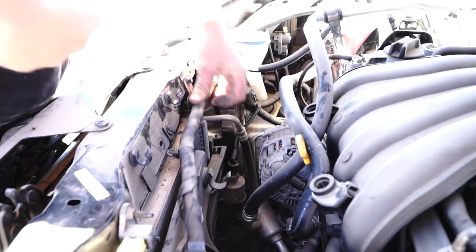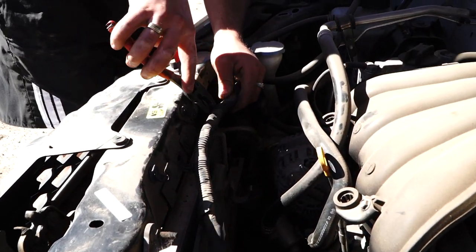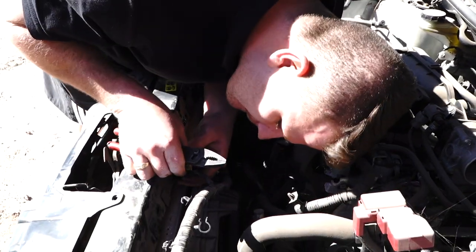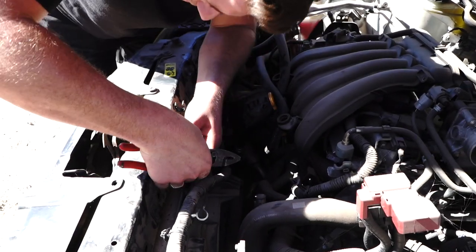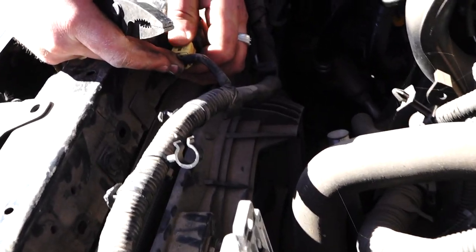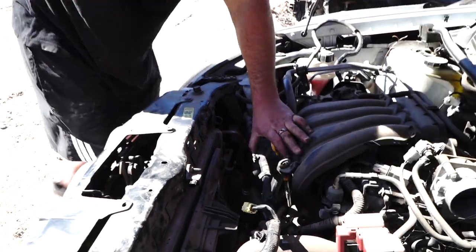Just here, we're pulling it out. See how that wiring loom has now come off the body? And the final step is this little plug, and usually it can be a little bit of a pain. So these ones — you grab the yellow plug like this, you push it back that direction, and it pops off like that. Now you can see the wiring loom is actually completely out of the way of our fan.